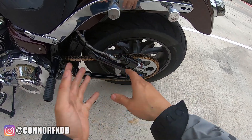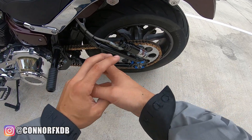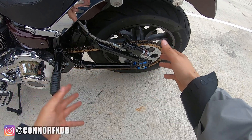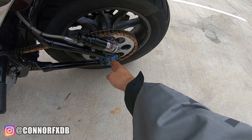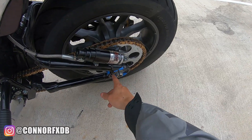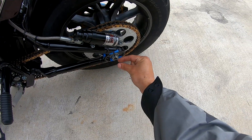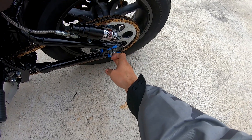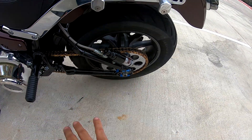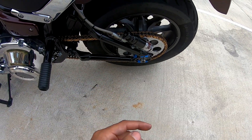I thought the chain could just be stretching itself at a new angle — that at one and a half inches it might be too tight, so it stretches and sags to two or two and a half inches. Looking at our axle point, you can see the axle is still roughly centered, so we still have some room to grow with the chain. But it's the increasing sag that has me on alert.